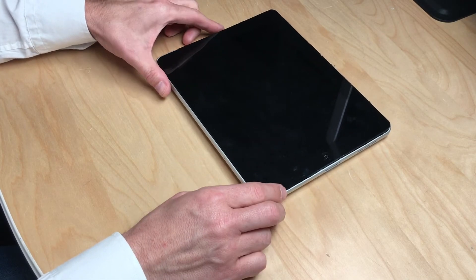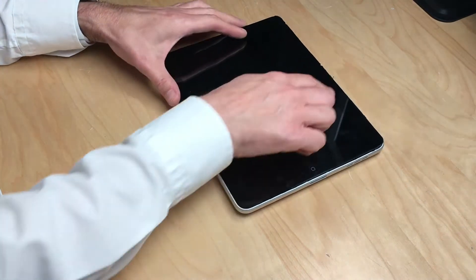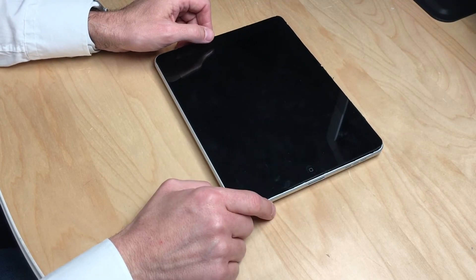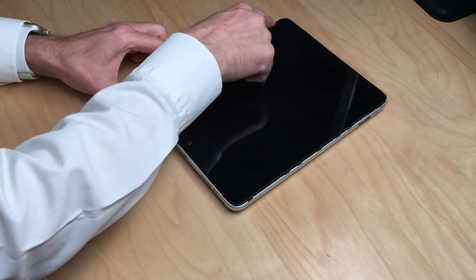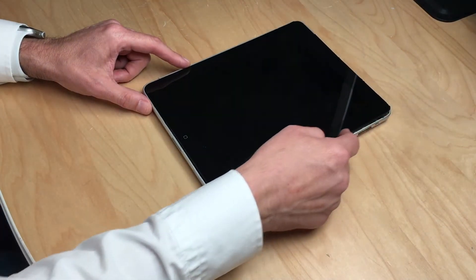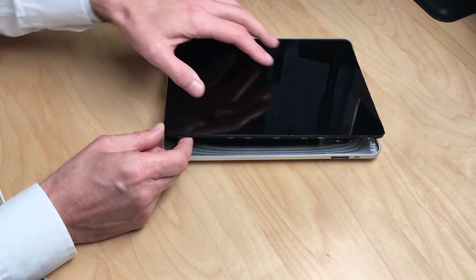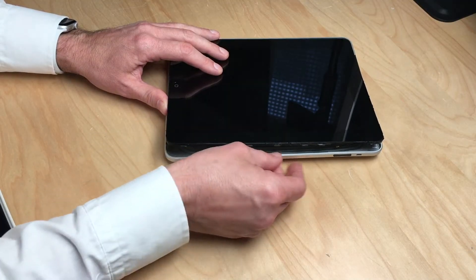To do this you have to open the iPad up, which I have already done as you may see. I'll show you how to turn this into an external monitor. First you have to cut with a knife around the edges of the iPad where the black line is — there's some kind of rubber seal which you have to break — and then there are plastic tabs which hold the top containing the display and the touch device inside the metal or aluminum shell.